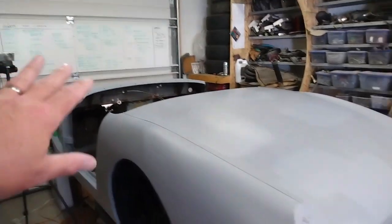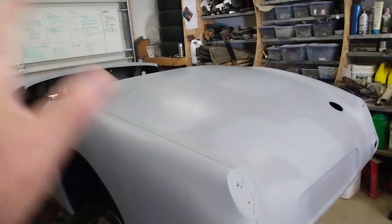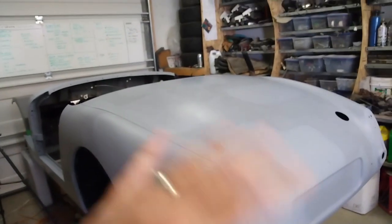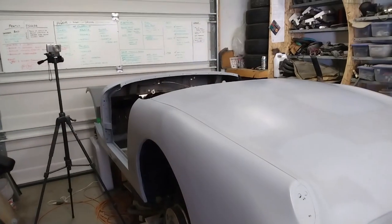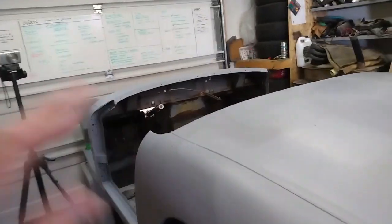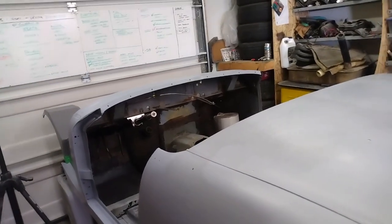The main part of the car is ready to go. It's been sanded 180, then 320, then 400, and then wet sanded with 600. I've done a few patches along the way but everything's nice and smooth and clean. I'll give it a good clean, then mask it off, do the tack cloth, and then we can get to spraying.